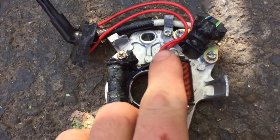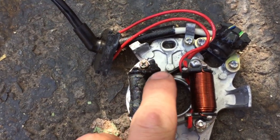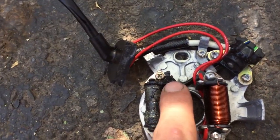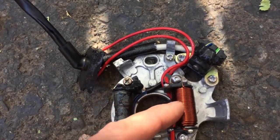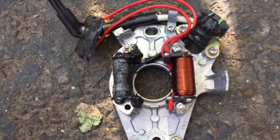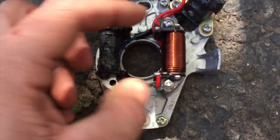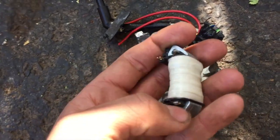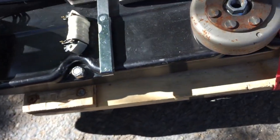If I run oil in there, on the stator plate I'd want to put some gray silicone to insulate the solder points — there would be four points total: where the coils connect and where you connect wires to the CDI. All the magnet wire is varnished so it should be pretty well insulated, but I'd want to cover those four solder points just to be safe if running oil.